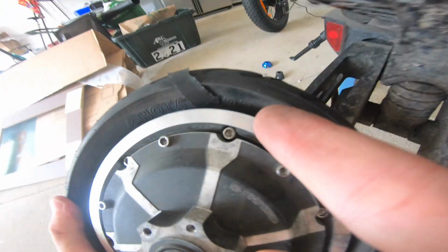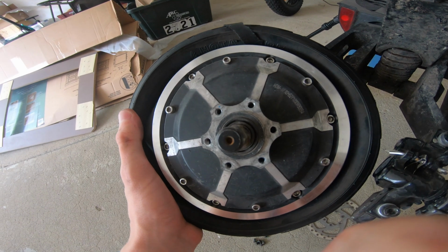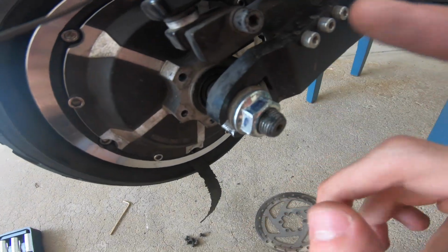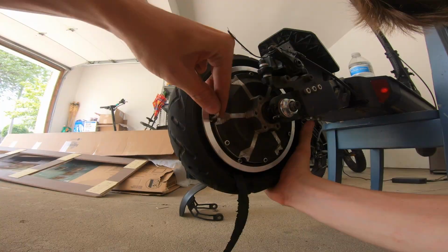But you guys want to make sure to take these out. Do not unscrew these ones, only the inner ones, and then the rim should pop off, and we'll show you what to do from there. One quick tip I like to give is to put the locks back on and the bolt to make sure I could take them off easily without the wheel sliding down.